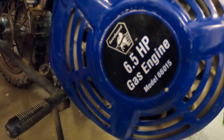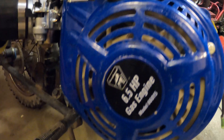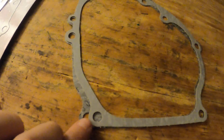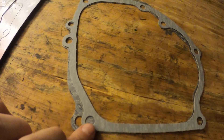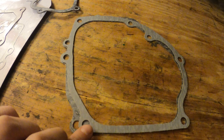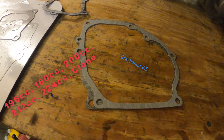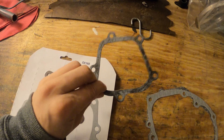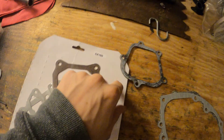This is the gen 1 Greyhound Harbor Freight motor from years ago — it's on a rat rod so I can't do a true side by side. These motors do have different side gaskets on the clutch side. One of the bottom holes is slightly over by about a quarter inch. The top gasket is the specialty 196 gasket — I had to find it; Childish Concepts had it, shout out to them. The bottom one fits pretty much every other motor they make from 160 to 200cc. The Greyhound valve cover gasket also has five bolt holes while everything else has four.